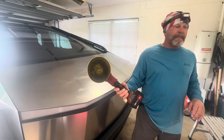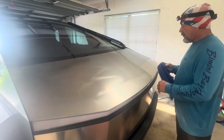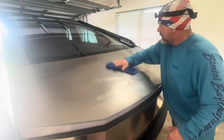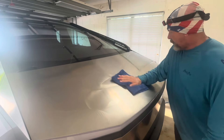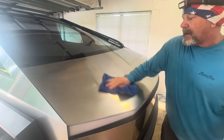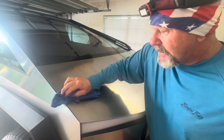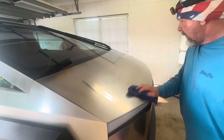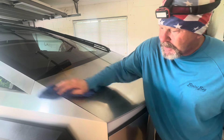Not a lot of polishing. You can see how black the pad is getting. We'll go ahead and take it off — seems to come off like any other polish, pretty easy, not a lot to it. We're going to use our panel prep two, three, four times on here until we're able to wipe it without getting any of the black rouge onto the towel. I can tell this brightens it up just a bit. I'm really just trying to even it out and take off any little stains and watermarks that were on here that did not want to come off in the wash and clay process.